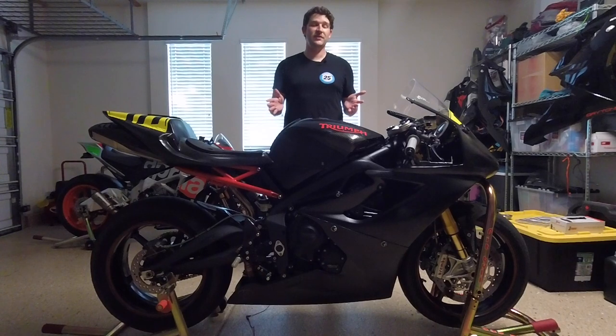Like I said at the beginning of this video, this is a pretty involved job. It does take a good amount of time and a lot of attention to detail just to make sure you're not messing anything up. If you have to adjust your valve clearances, you're playing with the timing of your engine, and if you're not careful turning the crankshaft when you're checking the clearances, you could very easily let the crank walk back, change slack on the chain, and have a tooth skip on the cam, in which case you gotta pull everything out to reset the timing.